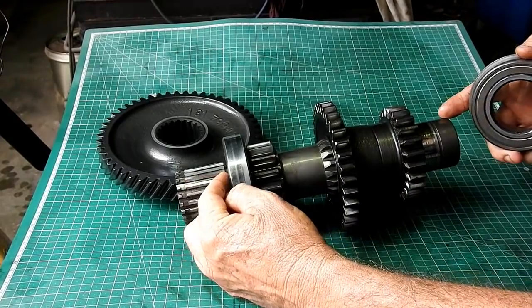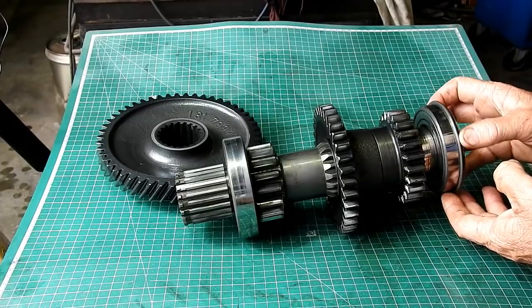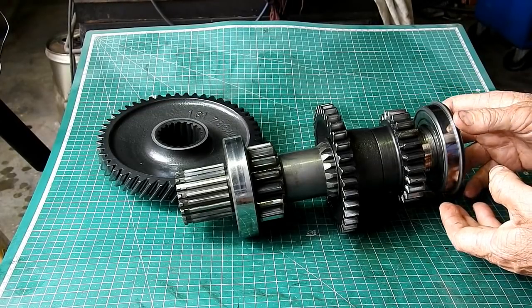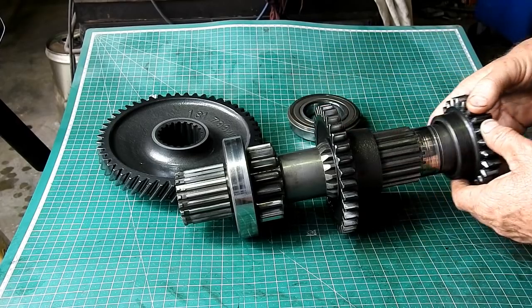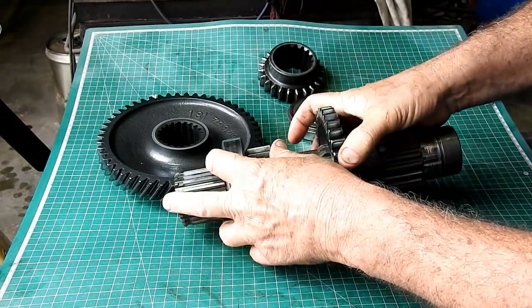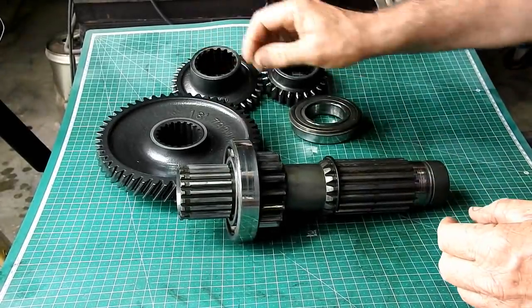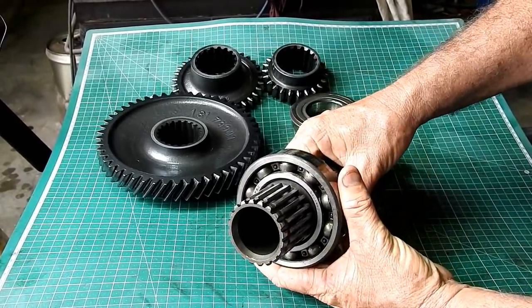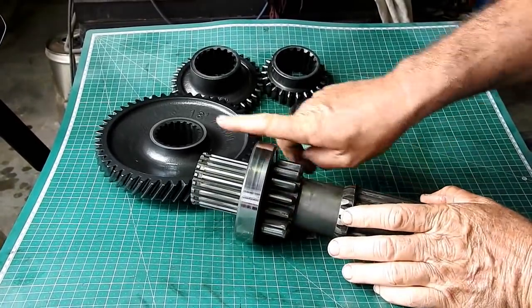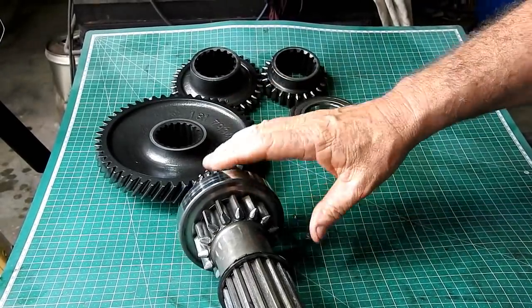With the other gears in place and the other housing — I think it's the epicycle housing — coming up against that bearing stops it from moving. So we take our third gear, second gear, and that off. To get this shaft ready for assembly, we have to pop over to the press and press this bearing off. This bearing comes off that way — pretty self-explanatory. You can't get it through the teeth.